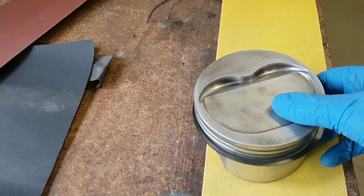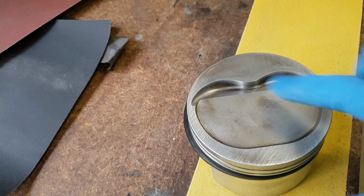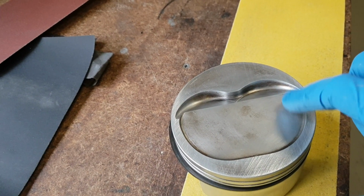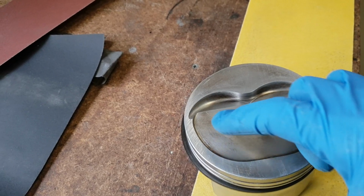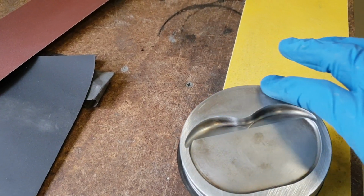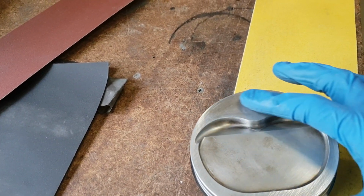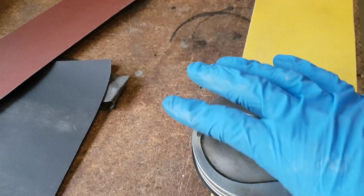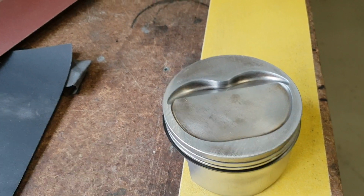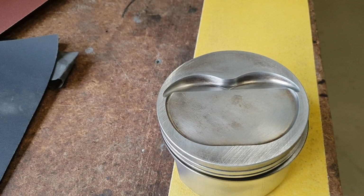Every time I do 15-20 strokes, I'd get the feeler gauge, and that was the same as the other piston. I ended up checking 3 points, and I was very mindful that there was a lot more material here, so I had to keep the weight fairly well over that part so we could get an even wear mark on it on the way down. And like I said, it didn't take that long.